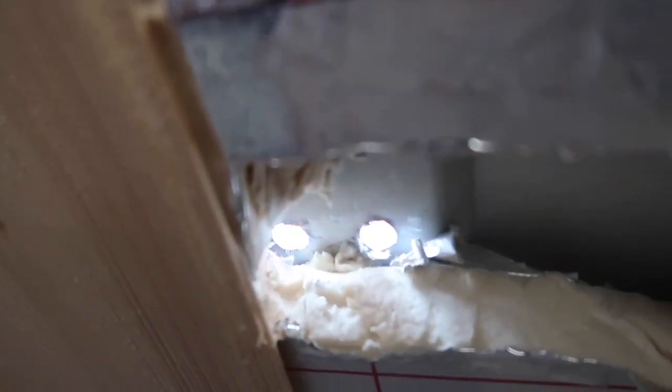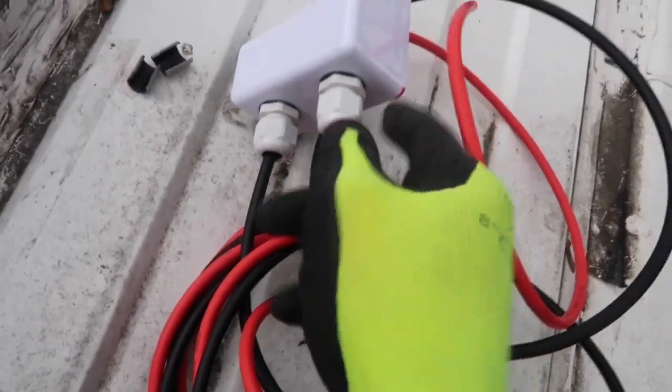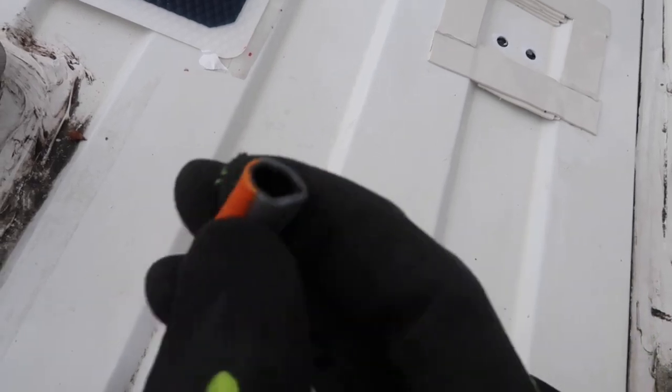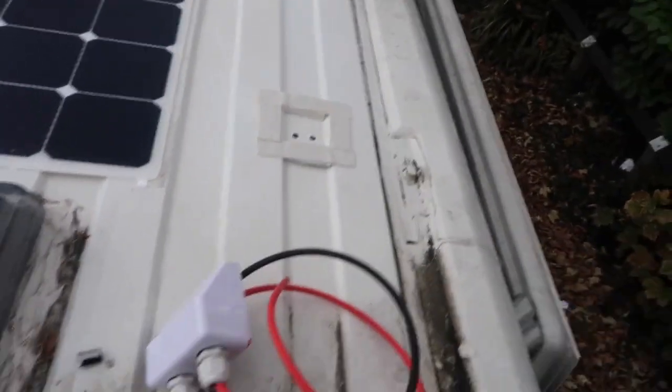We've got two holes coming through the van - you can see daylight. All our celotex work is ruined, but that's fine - we needed to ruin it to get the cables through. We've meshed it and fixed it the same way we did the solar panel and the vents. The extension cables just plug in here, and then the cables go straight into the van. You tighten it and it makes a watertight seal as long as you seal around it with Sika Flex. I didn't have any grommets so I've painted the bare metal and I'm using a cut garden hose throughout the van - cut to size to make a nice little grommet to protect the wire from rubbing against the metal.